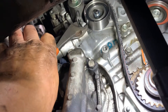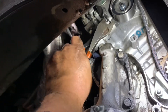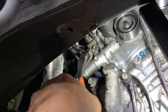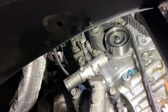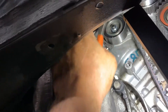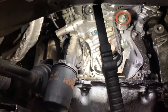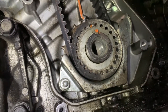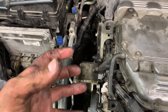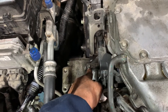Pull the pin out. That's it — it came up against the tensioner pulley and now it's tight, all good. Now I need to take my bolt out and put my washer back in there — remember that washer. Now it's time for the mount bracket. Get the motor mount bracket in there, get all three bolts started, torque the two top ones, and put the little 10 millimeter head screw on top — the one you took out earlier.